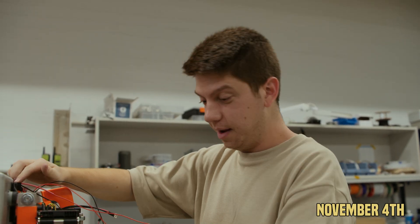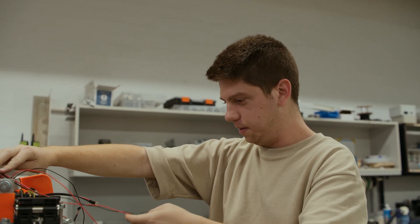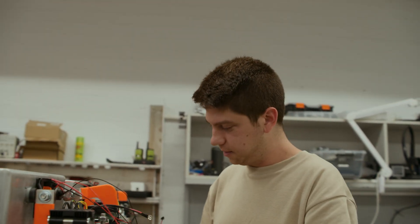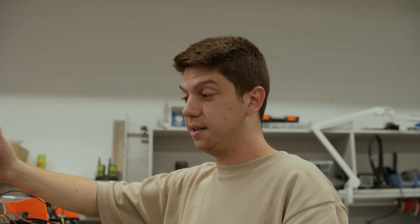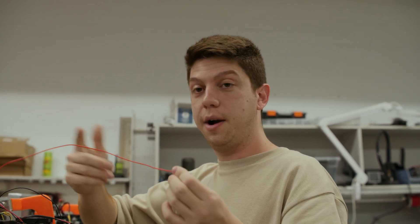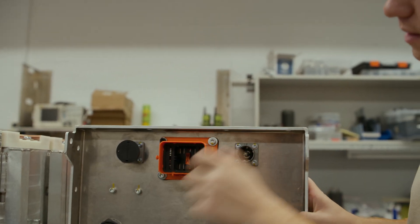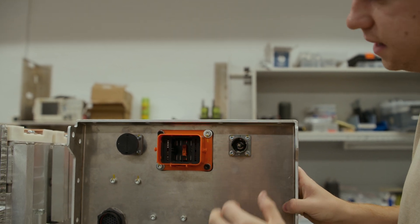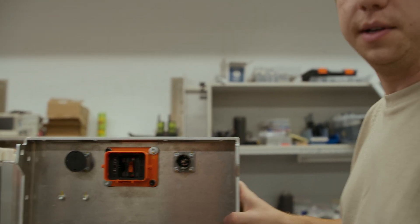I am attempting to turn a bundle of wires into something that will function. In here we've got things like CAN buses, contactor power, a master BMS under here, and everything is really constrained space-wise. The current thing I'm working out is HVIL — the high voltage interlock. Basically, if one of these wires is to break, fail, or a connector comes out, it will open the HV line. Its other intended use is: if this connector is not attached or fully seated, or if the MSD is out, any one of these points will open that line and our contactors open instantly.